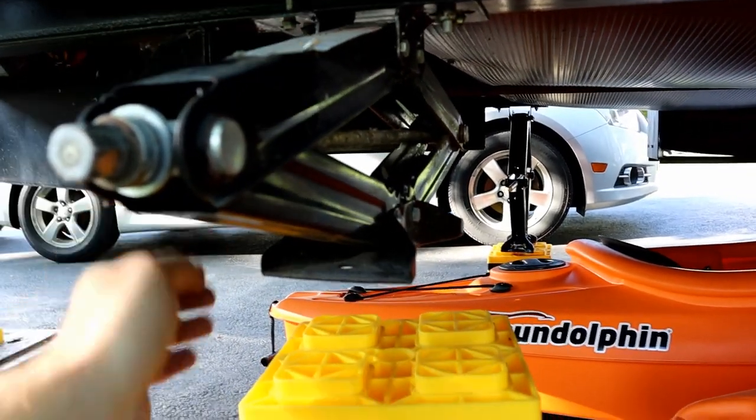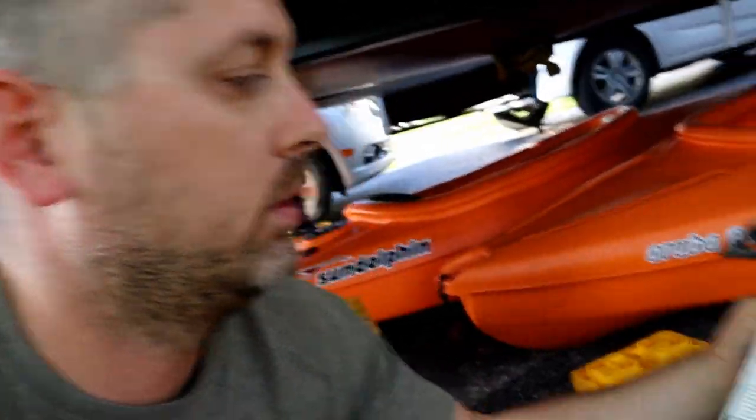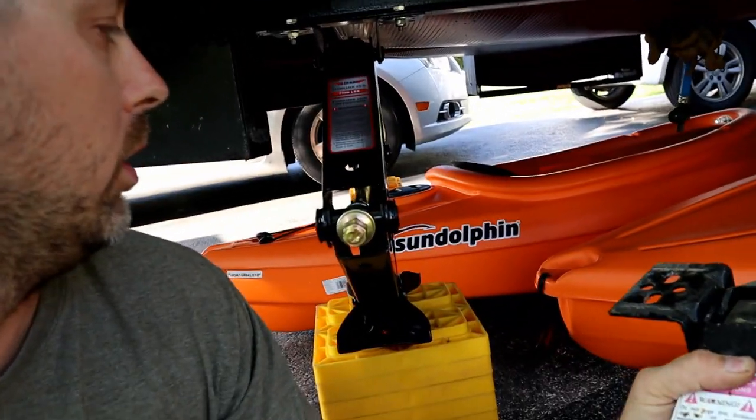They're really chintzy. Let's get the other one on. The holes — we've got to drill them just a little bigger. One is fine, but the other one where it had a screw versus a bolt is a little small. The patterns don't line up — two holes pretty much line up, but you've got to make the hole one size larger than the 5/16ths. So we're using a 3/8-inch drill bit to drill out the two holes so the bolts line up with the new jacks. We've got one more down, one more to go. Old crappy one, nice new one — makes a big difference.